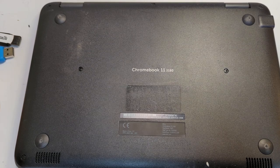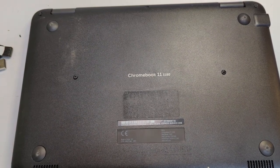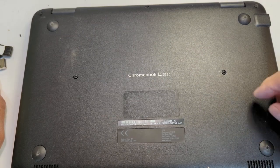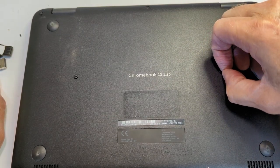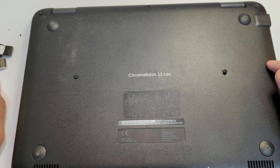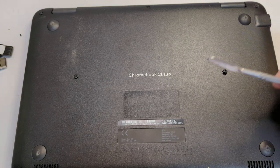So I've removed — or rather loosened — the screws. On this particular Chromebook the screws do not come out all the way; they loosen completely but will not come out, as they're tapered on one end. That's good because you don't lose any screws. On many other Chromebooks the screws do come out, and I put them in a little magnetic pan so I don't lose them — but these are unique to this model.